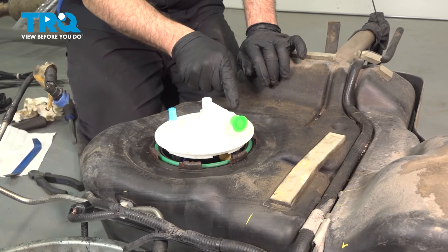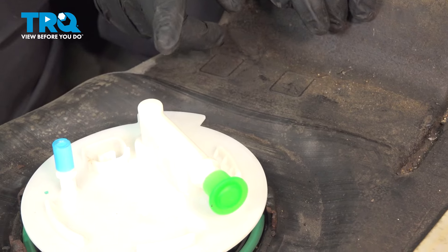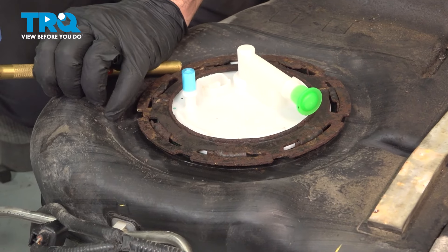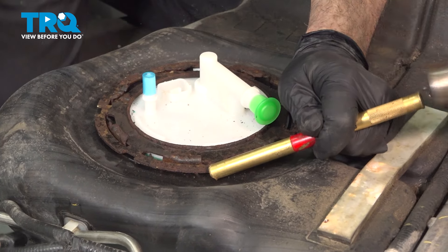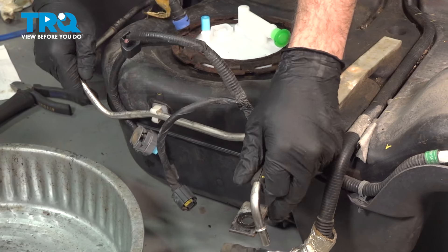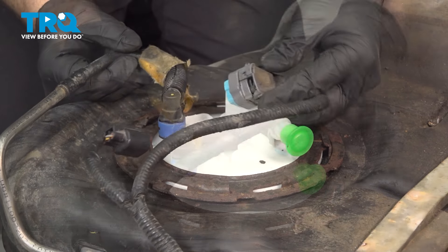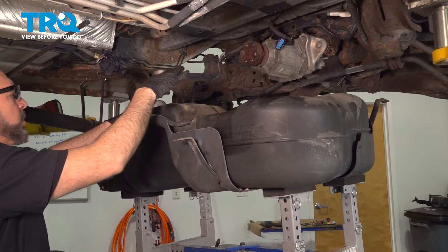Pull up the whole thing. This tab fits into a notch and there's an arrow on the tank itself pointing inward — that arrow should line up with this tab. Press it down into place. Go ahead and get that lock ring started, press it, and using your brass punch, anchor that lock ring. With that secured, push that fuel line over, remove the cap, press the fuel line down, and install the locking clip. Grab your electrical connector, line that up, press it on — you're going to hear and feel it snap into place. Now raise the tank up into place.